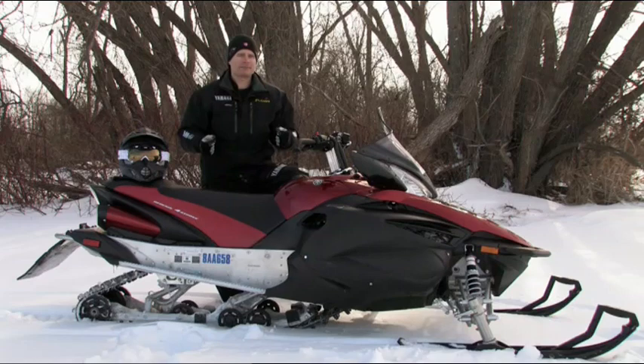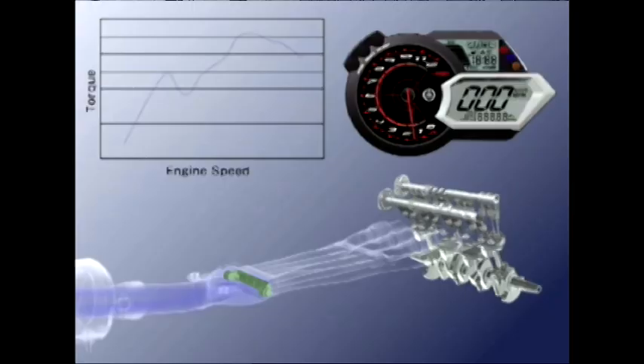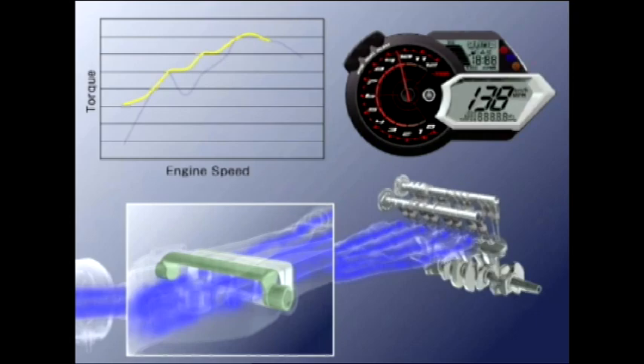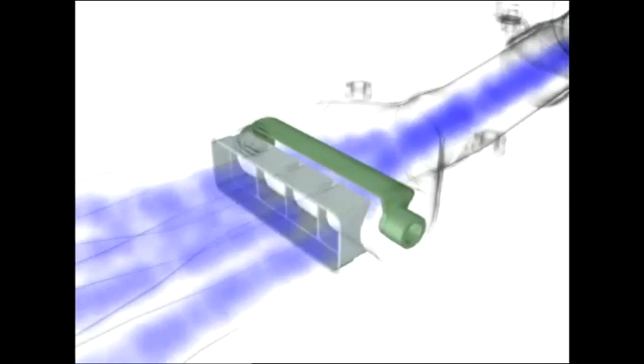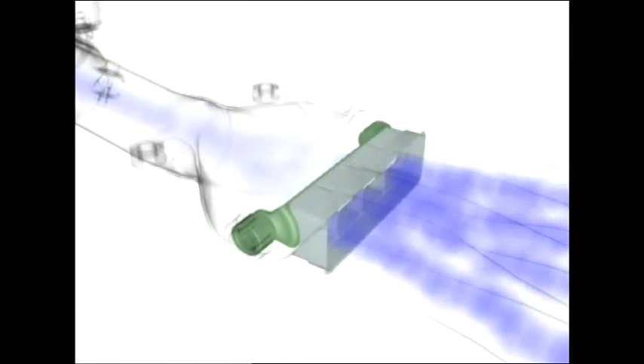We've added something from our motorcycle division called X-Up, or Exhaust Ultimate Power Valves. What X-Up basically does is control the rebound reflective exhaust pulses. Those exhaust pulses in any exhaust pipe are already tuned to a certain length to peak and boost power in a certain RPM range, but it also provides some dips in the power curve as you go up the engine RPM. X-Up allows us to eliminate some of those dips in the power curve at RPM ranges that aren't tuned specifically to the pipe length. X-Up is basically a clamshell that opens and closes at the end of the exhaust header before the muffler, and changes how the exhaust pulses reflect back to the engine.